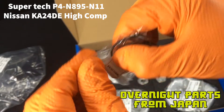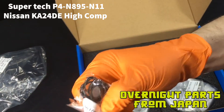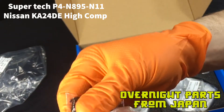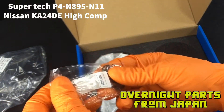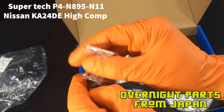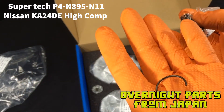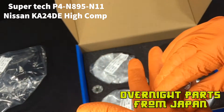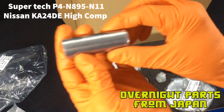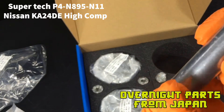Now these are the clips, which is a nice feature — even though I had a hard time opening it, I was trying not to rip it. They do include 10 clips instead of just 8, in case you lose one or two. They are prone to shoot across the room. Wear safety glasses when installing these — this is a great way to lose an eye. I've seen it happen in the shop. They're fairly easy to put in, but there's a right and a wrong way to do it. These are chromoly wrist pins.